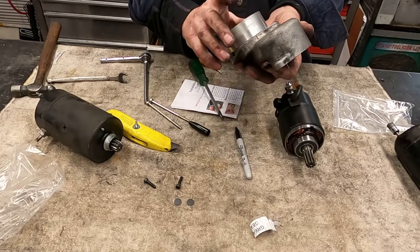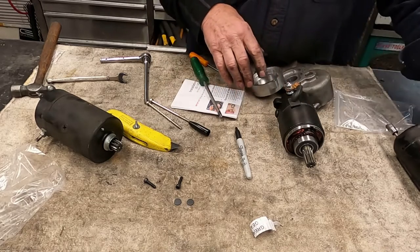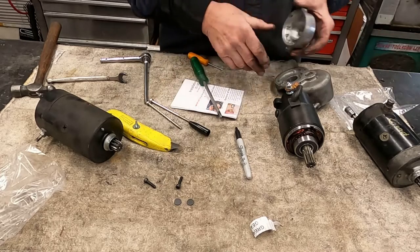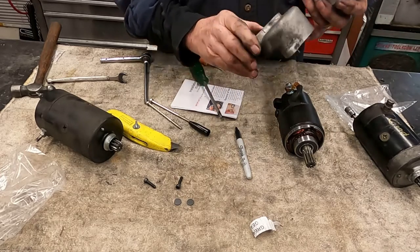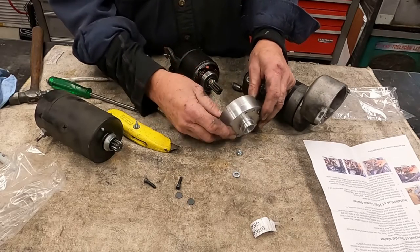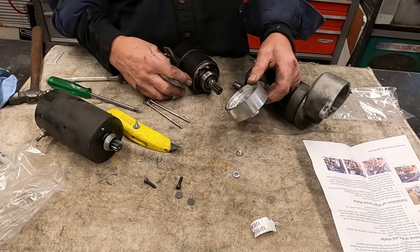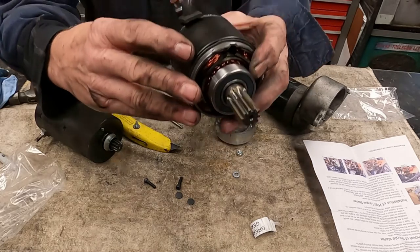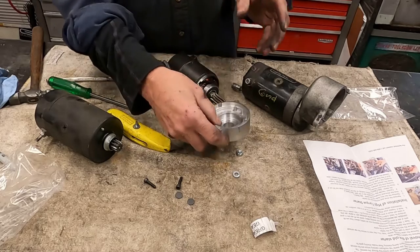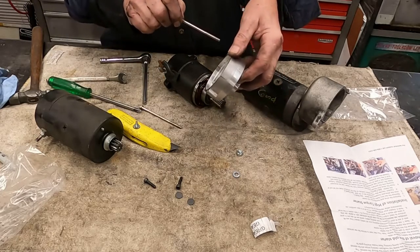So what I'm going to try to do is I'm going to try to line this up with the mark. What I did is I followed the mark from where this post is going to be and marked it on this unit here, and also on here to help me line everything up. I put a new lineup mark on the new starter housing. What you want to end up doing is lining up with this little mark right here — there's a detent that is supposed to fit in this area, and there are actually two of them. I've lined up on this one here and then when the screws come in, they'll pull everything together.